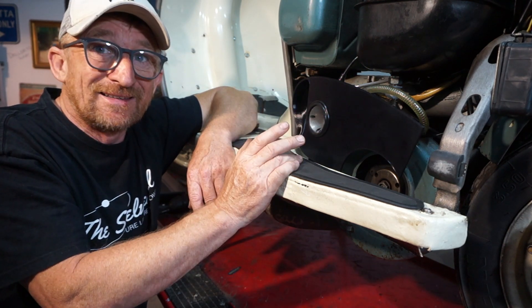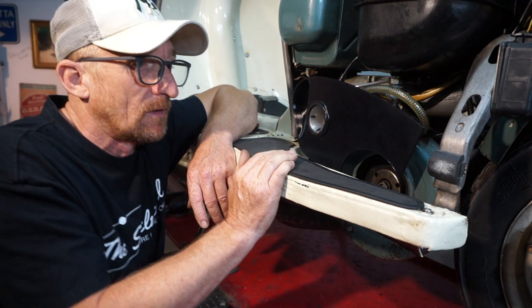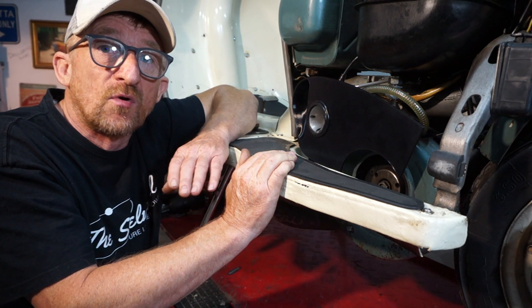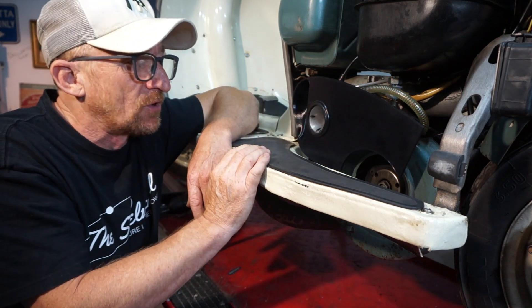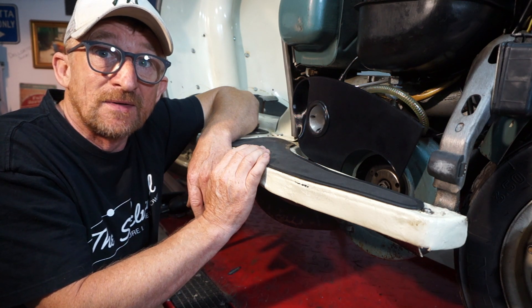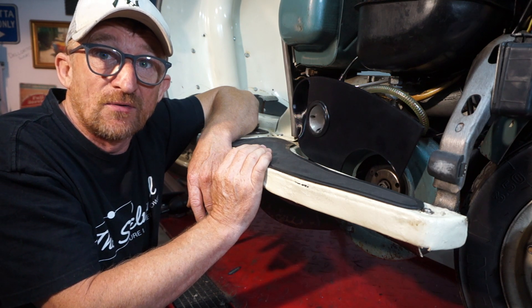The air box is calculated — it's 1.5 litres of air inside, which is more than enough for up to 250cc. For an air box, it's good; it's going to flow well I think, but it's all down to the testing. So we need to get this prototype finished and on, and at least be able to drive it down the road.